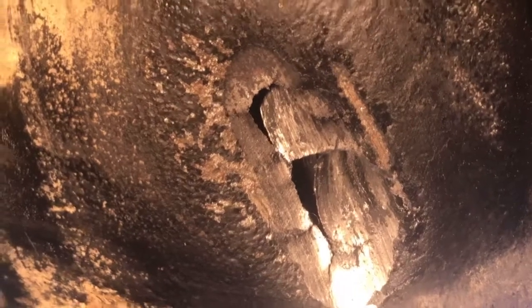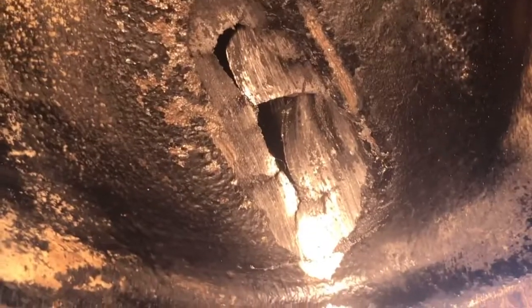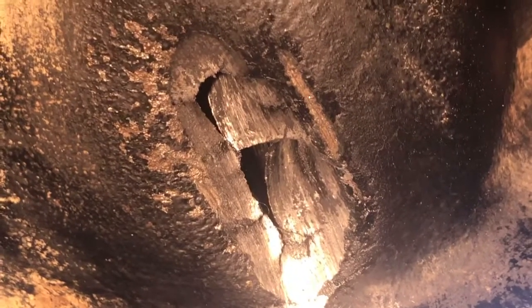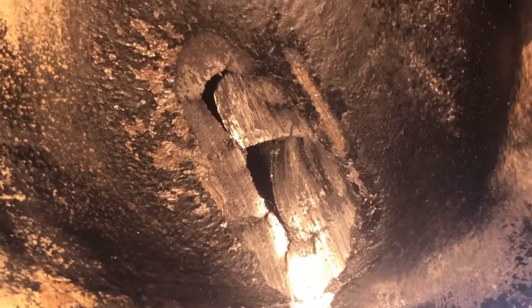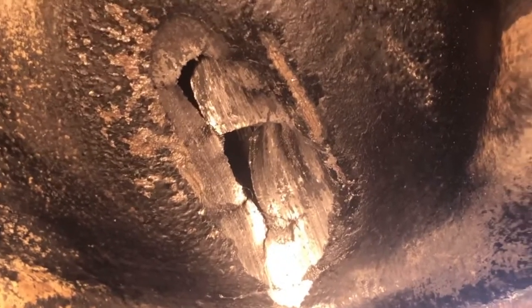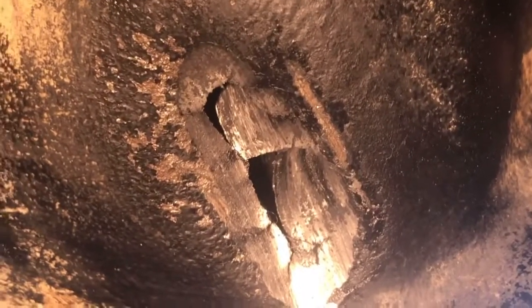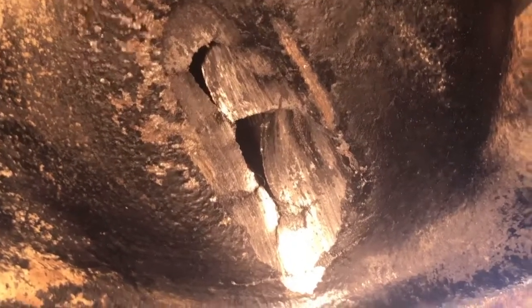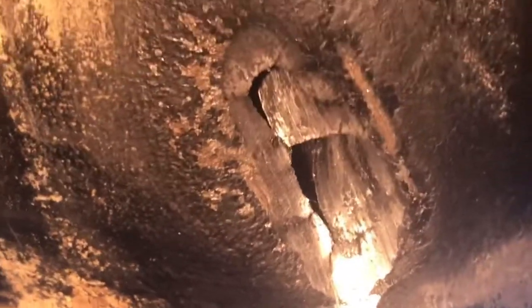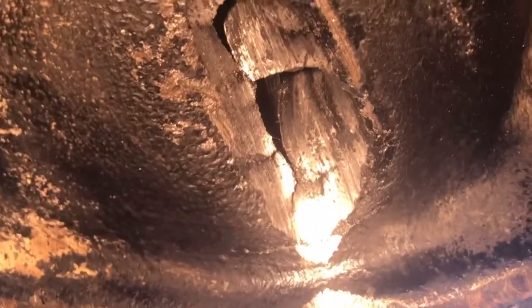To maybe get in there with a hammer and or a little Dremel tool and just grind some of it down so that it's just farther away from the ring gear. You can see from my other pictures. I'll get in there with the video as well, but that's my sense of it. It's not hitting the ring gear, but it's like maybe a 16th of an inch under it. It's hard to say, but it is close to the ring gear for sure. So it flexed upward and in. So that's what we have, and I'll take a bunch of pictures as well.